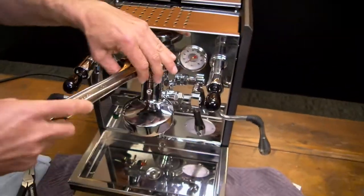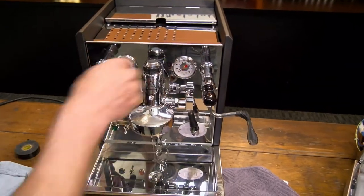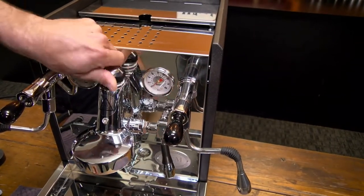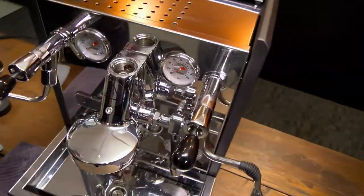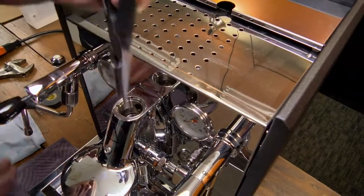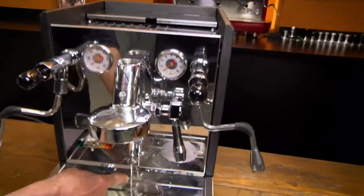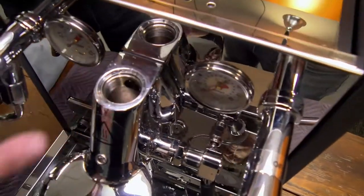Make sure it's fitting snug and just loosen that up. You'll be getting a little bit of water coming out of the top — there's a little bit of pressure in there. Pull this out and then inside you'll have a spring and an actuator, so pull that out. Now you'll notice water is draining into the drip tray, coming right from in here — it's emptying the boiler.